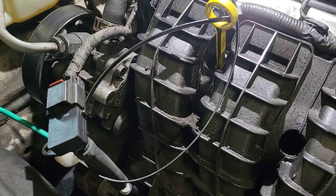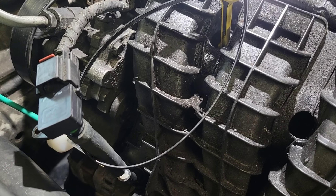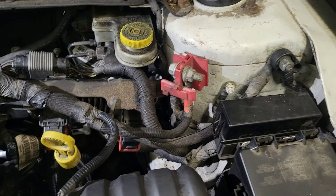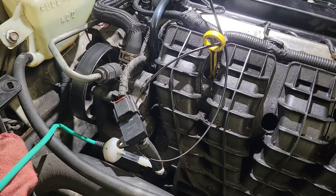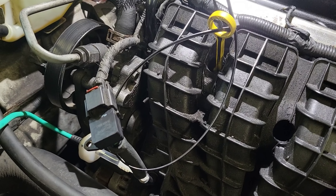The wires are greasy, so the easiest way I find is to attach to ground and then look for the five-volt reference, because you're going to have voltage on two of the wires and touching ground to ground isn't going to hurt. If you jump power from a test light, you don't want to hit that five-volt circuit — that's not going to be good. We go with the least invasive way, finding either the five-volt or the barometric pressure on the signal wire.